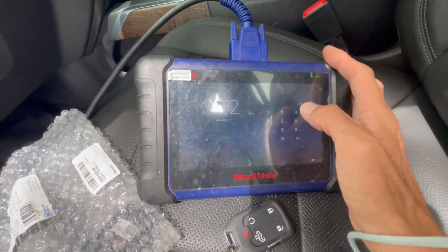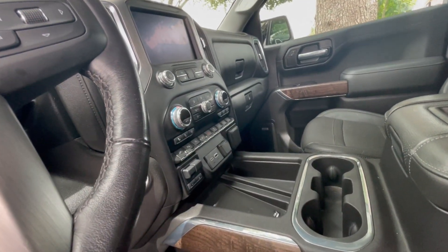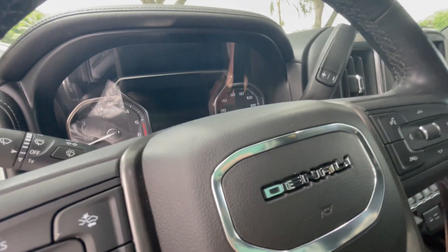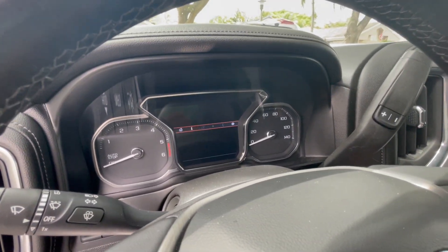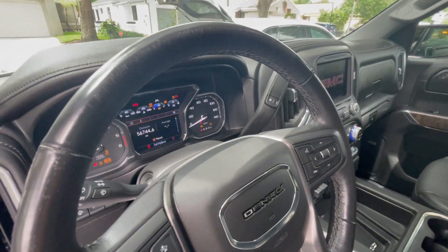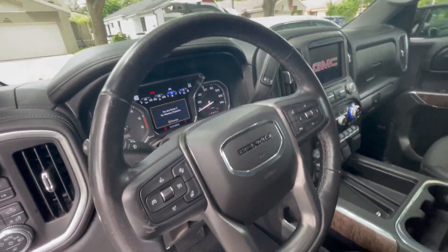Make sure you connect it to the internet and you can put the hazard lights on. In this case we're just gonna put the ignition on, but if it's an all key lost it's gonna be the same — the car will put the ignition on for you. On GMs, putting the ignition on is just pressing the push-to-start for 12 seconds.